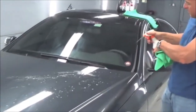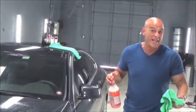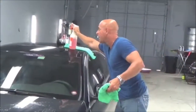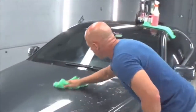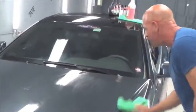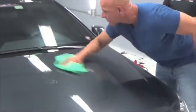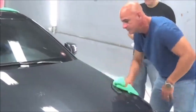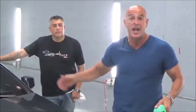We're spraying our pre-wash. How much did you put in here? Just doing a capful — about a capful to a 32-ounce bottle of water. You might be used to using paper towels, but it's an easier way. Anyone with a microfiber towel, it's going to wick it all up — anything that's left on the surface — get it nice and clean, get it ready for the vinyl. Our next step is going to be where you guys would normally use alcohol. I'm going to use our adhesive remover — it's going to get the rest of the wax and grease off that the first product didn't get.